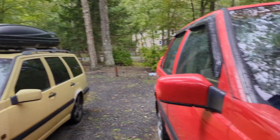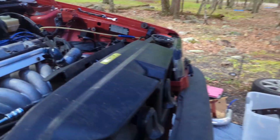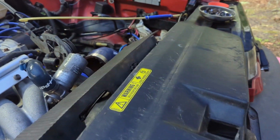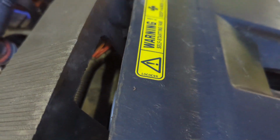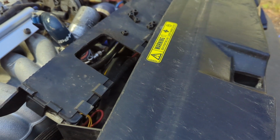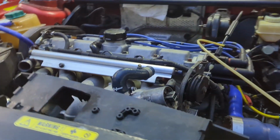Having some light rain, not the end of the day. However, intercooler piping may be the end of the day. We installed a DO88 intercooler, and I don't think the piping on the IPD rip kit fits the DO88 piping. That is 2.5 inches. I think the original intercooler may be 2.25. I couldn't even get the clamp on it on the bottom.